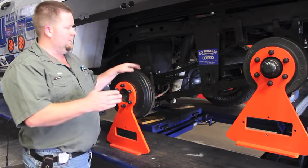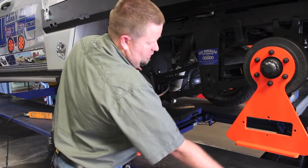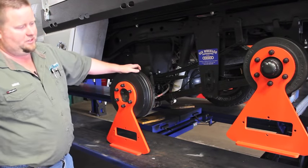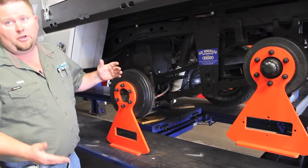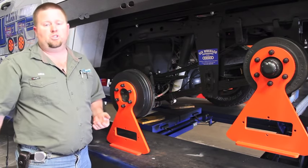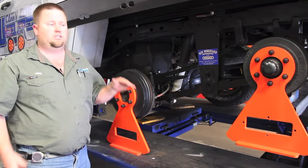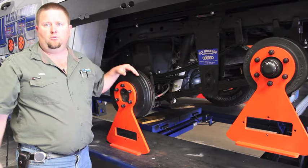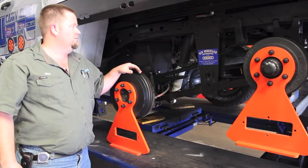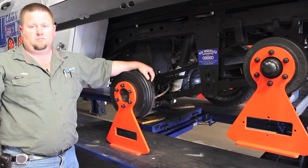Here, we've got it set up on the hoist, so we've got that jacked up, showing that you've actually got about 260mm difference in height between these two axles. With that 260mm variation between the axles, you will also get around about 70mm of squash in the tyres, so that equates to actually about 300mm of travel between your two surfaces, which is terrific in any terms, particularly for any vehicle that will work at a 4.5 tonne gross vehicle mass.